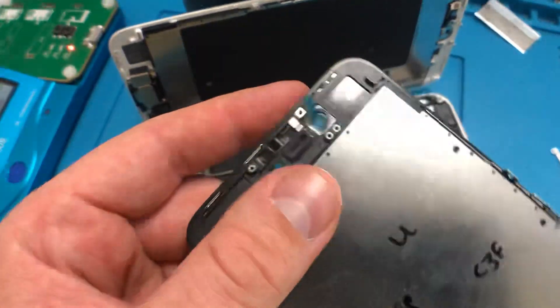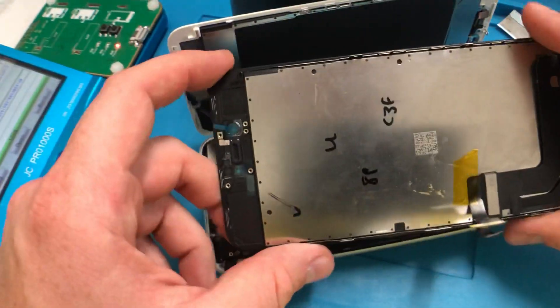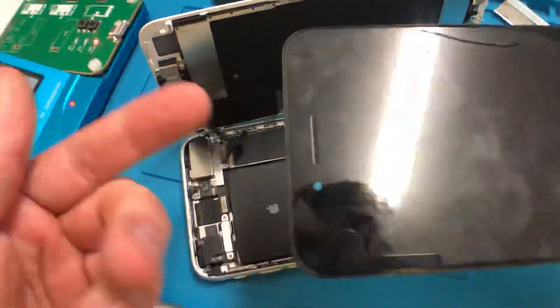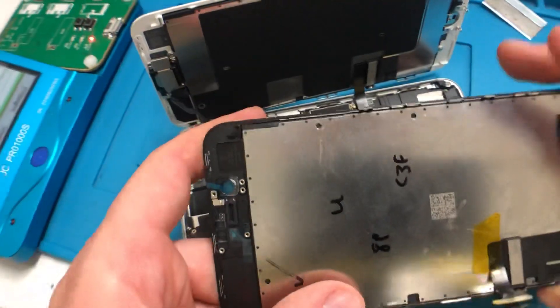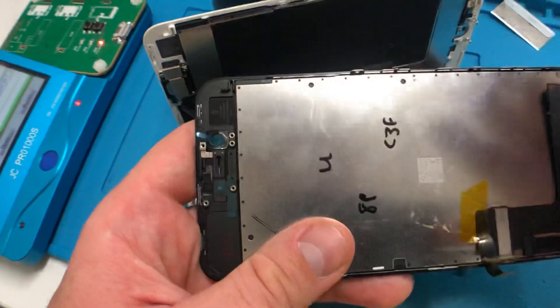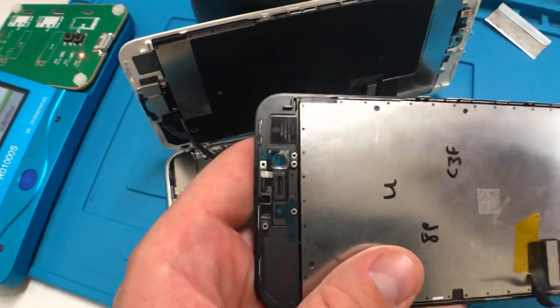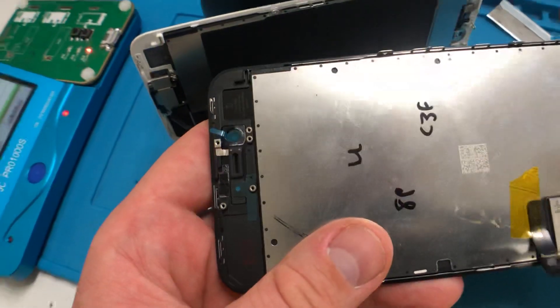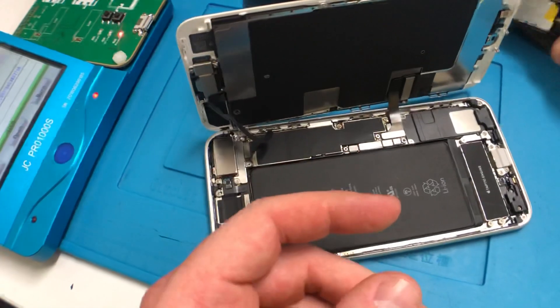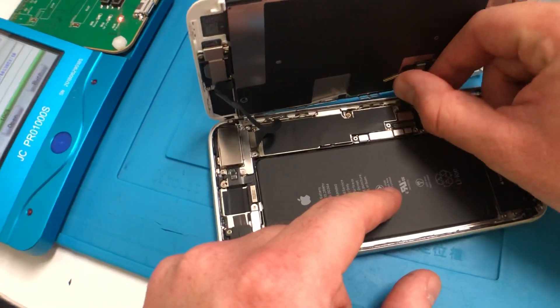To be very clear: the core panel in the middle is pulled from a cracked original iPhone 8 Plus screen. My guys have changed the front glass and the frame — the rest of it is as it was originally. So this screen has a different serial number to the display that is in the phone, but it functions the same as an original screen.